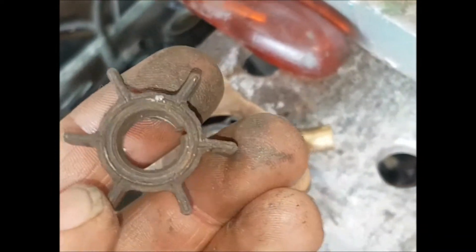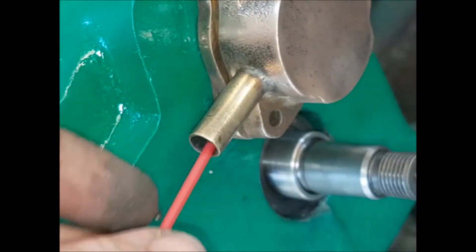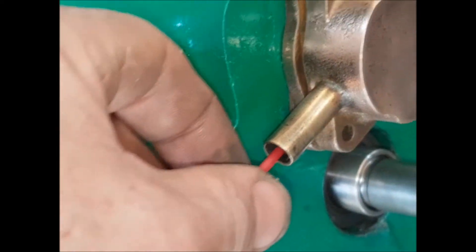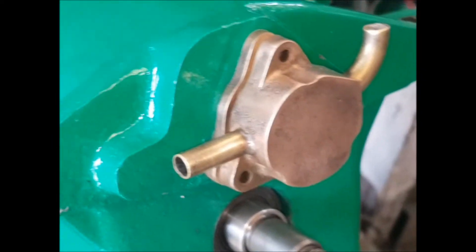Once the engine starts turning fast it might — like this rubbish one — come unglued and you've got a problem with slippage. So I think by putting a little thing in there to give it some resistance, if it then bites your stick when you turn the crank slowly, that means the rubber is engaging and pulling it round — so it's better than just looking through there. That's a good way of checking your impeller.